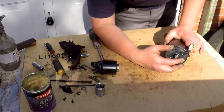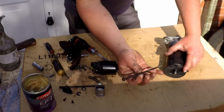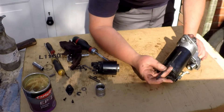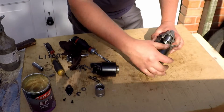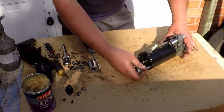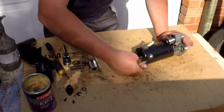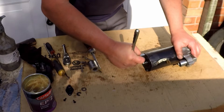So we'll just pop that in. You'll feel that little bit of resistance as it's all trying to merge together. And if you've done it right, the bolt will go all the way through the casing and start by hand. If it only goes halfway or a little section of the way, you know you've probably got a problem - particularly if it doesn't do it on the other side. Something's not lined up, take it all apart and start again. In my case it's a 7mm - just nipped up.